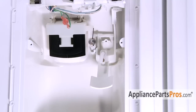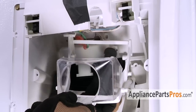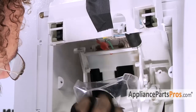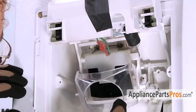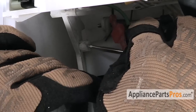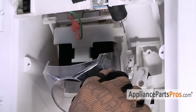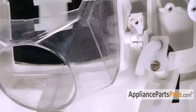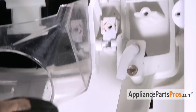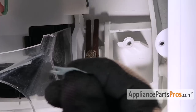Now that we have the part in, we can put the dispenser back together. As we're putting the lever back in, we want to make sure that we put this little black barrel through the middle of it, through the ice arm, and then put it onto its little mount. Then we can run the arm back around this plastic piece — you may have to take a screwdriver and flex this over so it snaps over. Once you have it in there, make sure that the right pin goes in its mount and the left pin goes in the hole. Once we have it back in place, we can put the little spring retainer clip in. Once you get it in place and started, don't forget to put the little paper spacer in there.